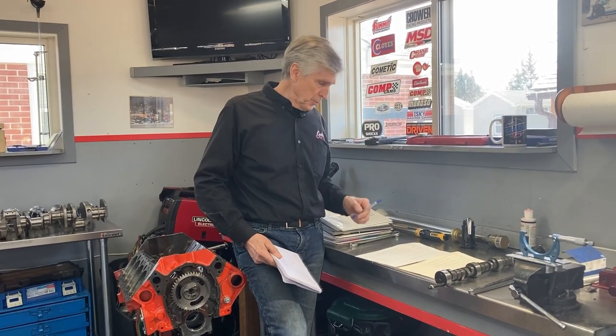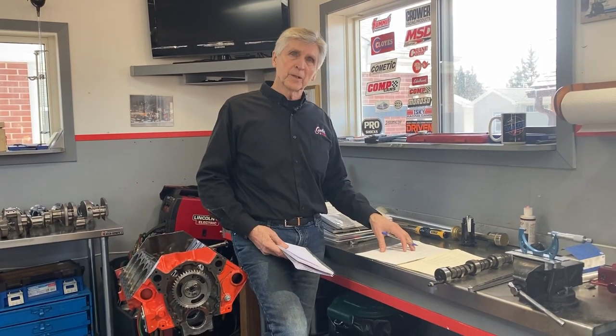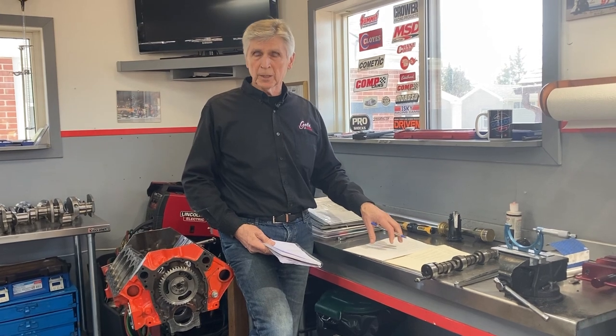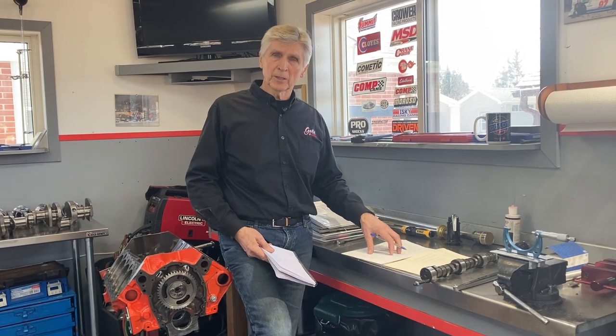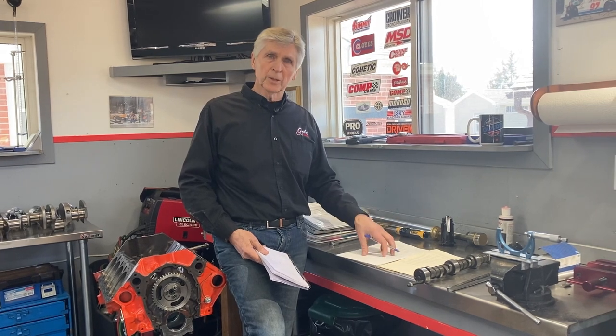The exercise was successful — 21 foot-pounds of torque is something you're actually going to feel in the car, and we made that gain right around 3,600–3,700 rpm, just where you're going to be driving the car. We conscripted the help of Austin Ward, a quadrajet expert, since this engine has a stock intake manifold and quadrajet carburetor from a 400 Pontiac GTO. He'll take over and do his magic optimizing it on the dyno.